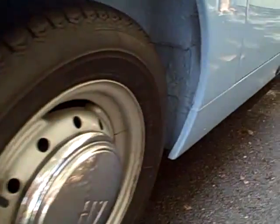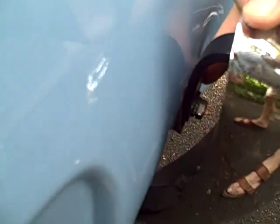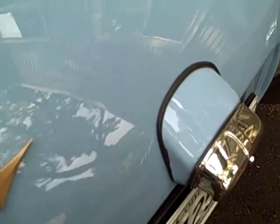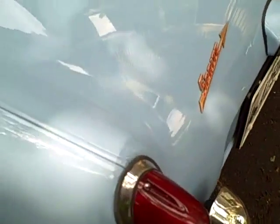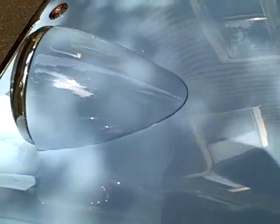When you find them all on one car, it's quite a special restoration. We've got nice matching blue paint — this is iris blue, all in the wheel well. That's as original. This is a weak area on bug eyes, so nice to see that in good shape. All the correct gear here and the right bumperettes — a little rubber pad there is also correct between the black upper mount and the body. This is the right license plate, plinth, and gasket. And of course there were gold Sprite emblems — that's what they were offered with, although sometimes now you see silver. This side is quite similar. We have excellent gaps along here — just everywhere you look, this is really a very special restored car.